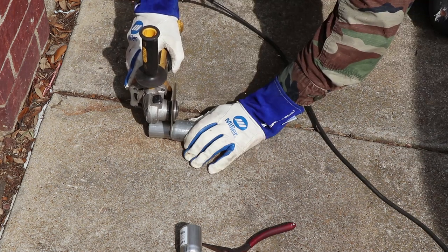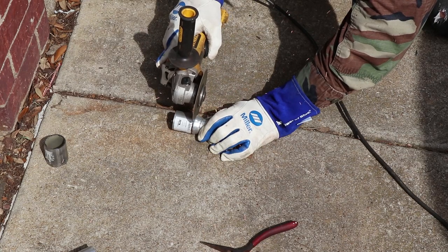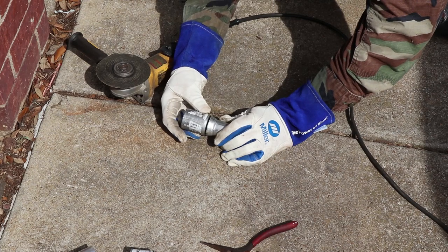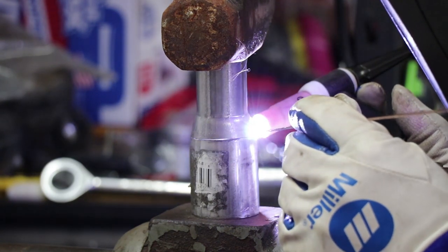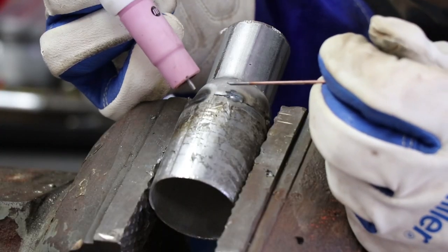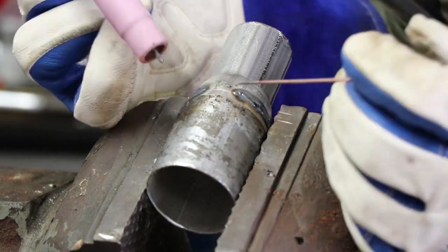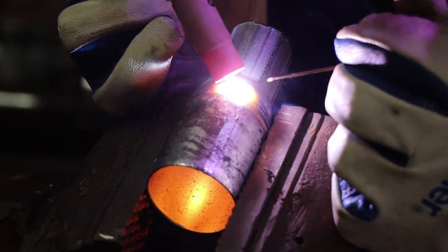This next part is where I'm taking step-down adapters. You've ever heard of a staged exhaust? I'm actually not making this like a true performance staged exhaust — I'm just cutting these so I can make the transition from a roughly one inch inner diameter exhaust to adapt to the actual muffler itself. What I'm doing here is TIG welding at around 40 to 70 amps and adding a small amount of mild steel filler wire. It's just aluminized steel exhaust adapters and it makes a really good weld and doesn't bunch up on the inside so you don't lose airflow.